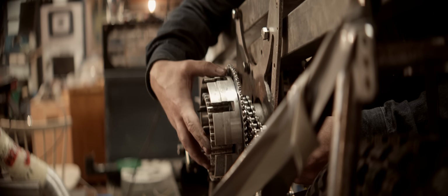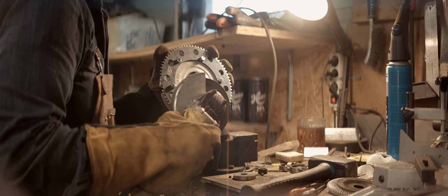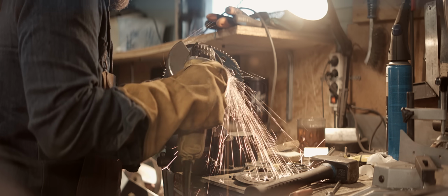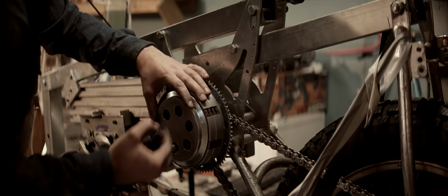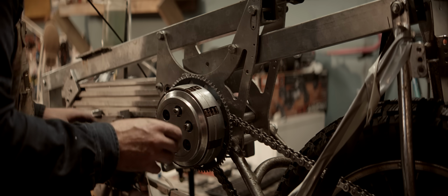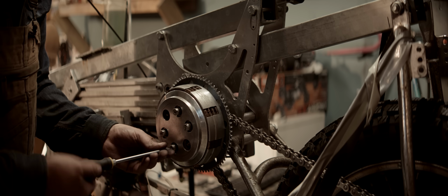So that won't work. I need to use normal nuts and no washers and super short bolts. Clearance is clearance. I'm using 4 of the springs versus 6 because this is meant for much higher torque than my engine can produce, and this is much easier on that pushrod thing we had troubles with. I haven't had any trouble with it after going down to 4 springs.